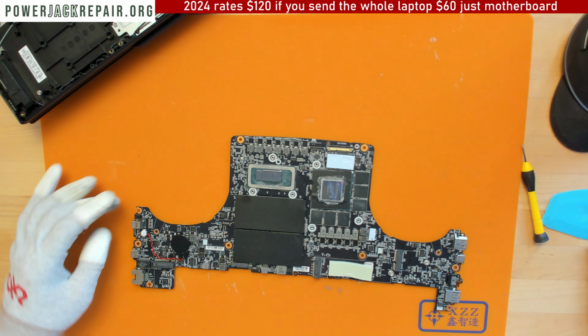Right, like that. Okay, good job. Excellent. Let's see. It doesn't show me that it went through. Doesn't show me anything here. Let me try this side. No, the board is too thick, you see? I have to keep the iron on it for a very long time, but the board is just way too thick. That blob, I don't like the blobs here.